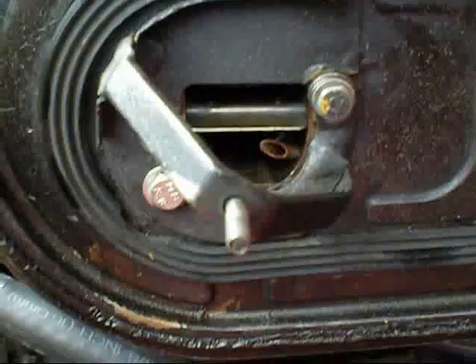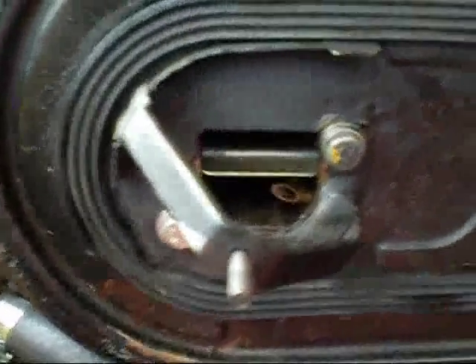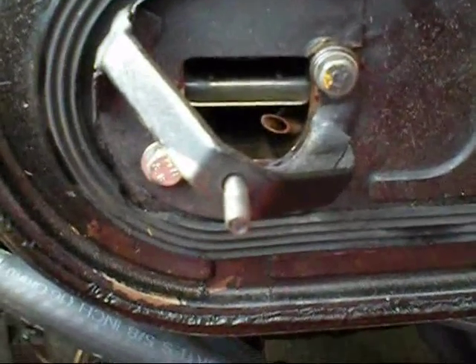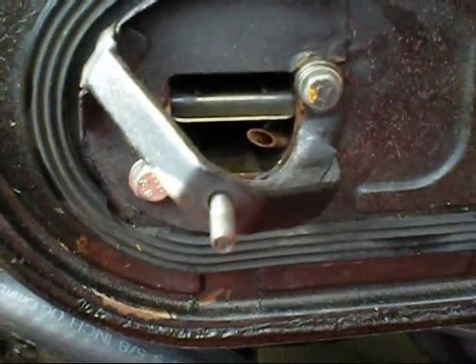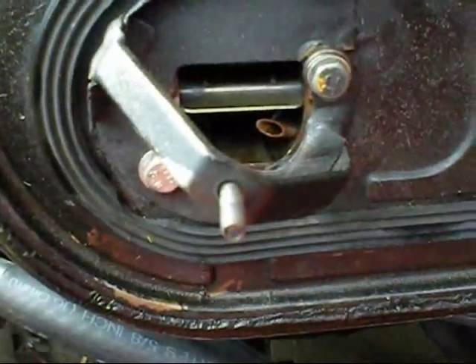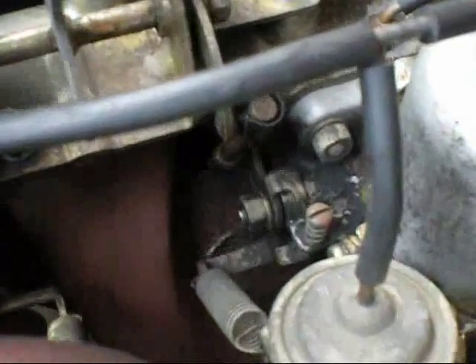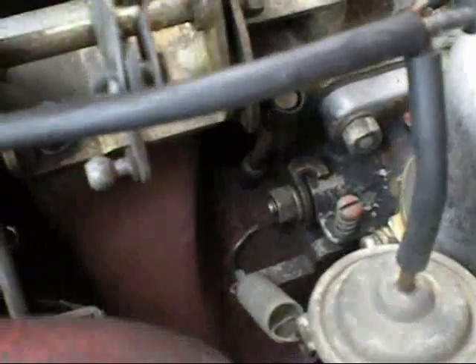You can't flood these for the same reason as the Jaguar, but these are a bit different. They have a manual choke, so if you leave that on they will flood. But apart from that they are pretty much the same. You've got your choke up here and your throttle linkage there, and all that does is just opens the butterflies at the back. It doesn't pump any fuel, it doesn't do anything.